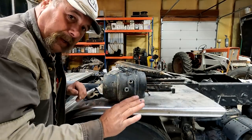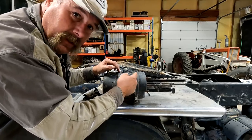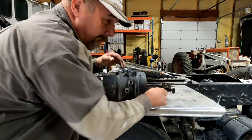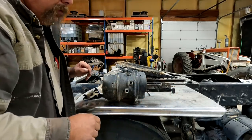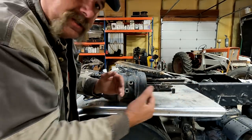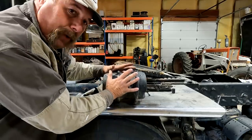So when you're hitting the brake on the floor, that is adjusting this air pressure from 10 to 30 to 50 to 100 to 30 to 50. It depends on how hard you push on the brake. That's what causes this shaft to go in and out and engage the slack adjuster, okay? The slack adjuster is in there so that as the brake pad wears out, it adjusts for this. So it adjusts the slack that's in the brake, okay? Slack adjuster. All right, so that's how our brake chamber works.